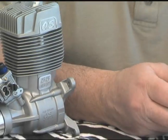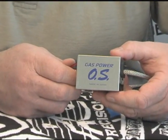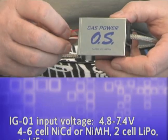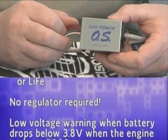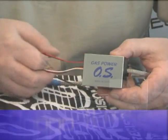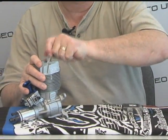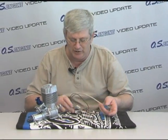OS also developed their own IG-01 ignition module. This is a capacitive discharge ignition module — a real nice module. One of its unique features is that it handles from 4.8 volts to 7.4 volts, meaning you can run a 4 to 6 cell nickel-metal or NiCad battery pack as your ignition pack, or you can run a 2-cell LiPo or lithium iron battery pack. You don't have to run any regulators with this ignition system. The high tension lead has a nice braided shield over it, and the cap fits on very securely but also comes right off — you don't leave springs attached to the plug or anything else.